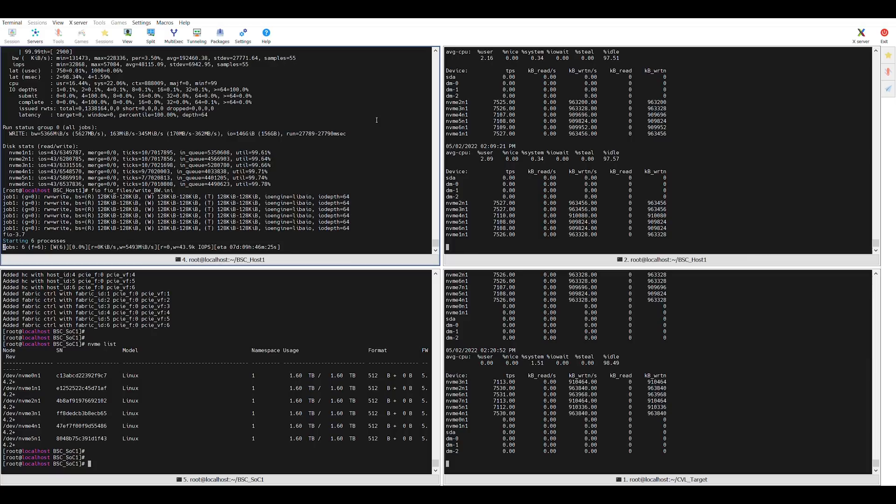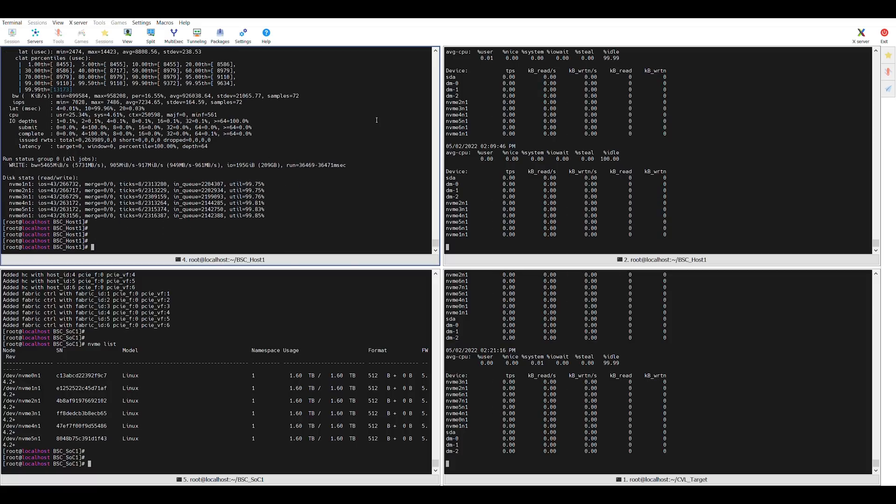Taking a quick note on the IO stats: the CPU utilization in both systems is actually pretty darn low. When doing sequential transfers at five and a half to six gigabytes per second, we're still only at around 3% CPU utilization. On the random side, we're maybe closer to 10%, but keep in mind we're running FIO on that host system — some of that CPU utilization is just generating FIO traffic, not actual drive access. Still, pushing 1 million-plus IOPS is only using about 10% CPU utilization, including traffic generation.